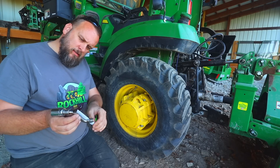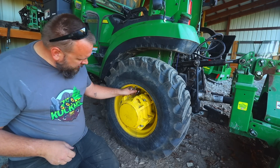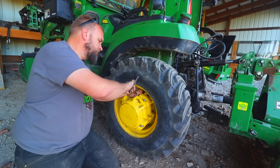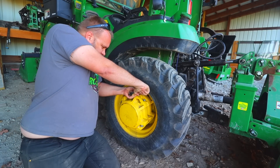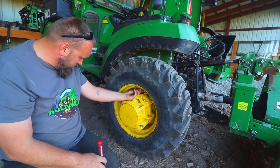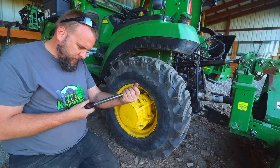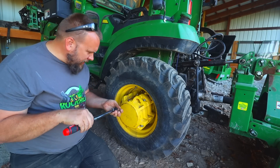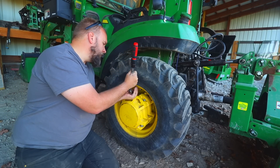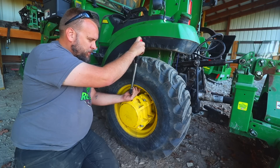So what we have here looks like about four and a quarter to four and a half inches. It's got to be an exact measurement to fit because you don't have a lot of clearance in here. We're on there. I can't tighten that bolt up anymore with this small wrench, which is another way of setting your torque. My extension is straight up and down. If I want to do this with the torque setting, I'm going to 83 pounds. To do it at 83 foot-pounds, my extension is straight up and down right now, so I need to ratchet this until it matches the angle of my extension. At 83 pounds here, I should get a click.